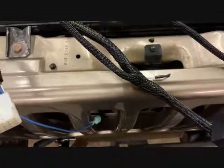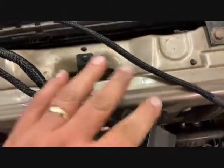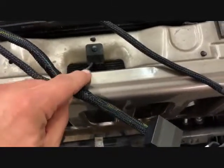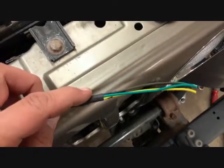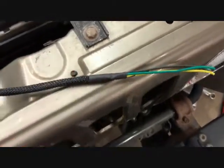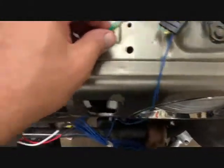All that excess wire that I wanted to remove, I removed. We put heat shrink on the ends, so what are now considered blunt-cut wires — that's the one for the GM trucks. Down here we have the high and low beam, also blunt cut with heat shrink on them. Then here where the trailer plug used to be, we cut that off, cut the braid back, exposed the wires, made the connections, and then put a little piece of heat shrink here to stop the braid from unraveling.